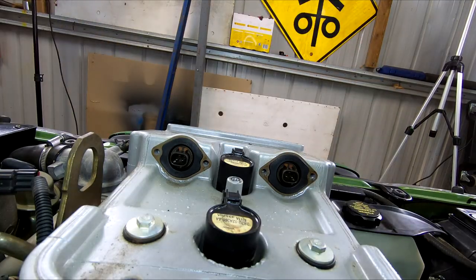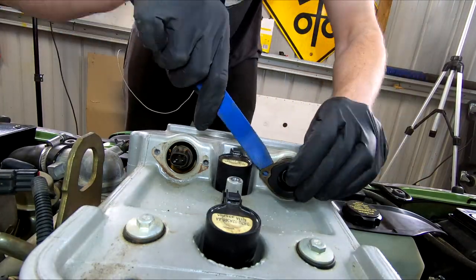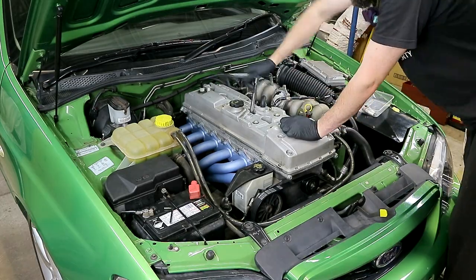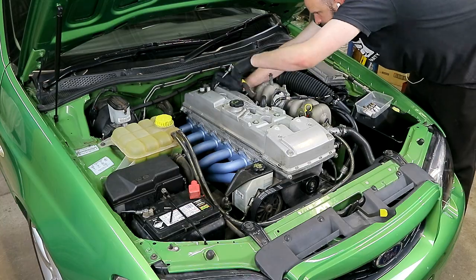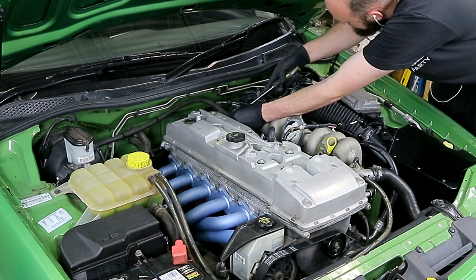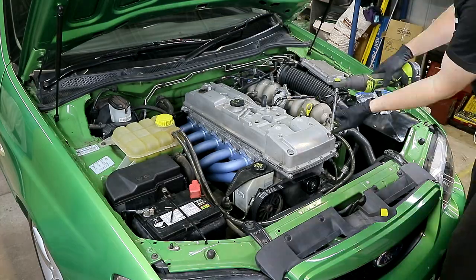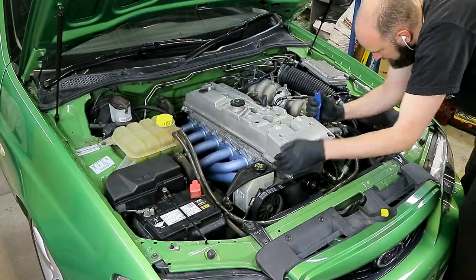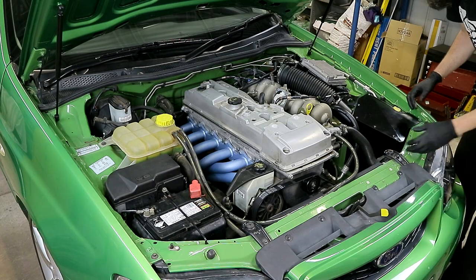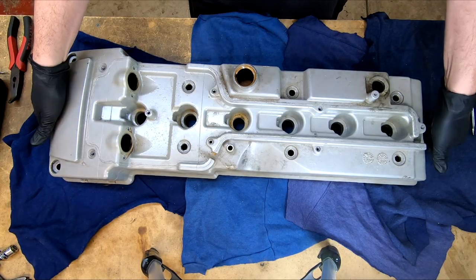On FGs onwards, I believe these cam phasers can be unbolted and removed with the cover on, but this isn't the case in these earlier cars. We'll have to instead move the cover backwards to clear these in a minute. Coils can be lifted out and spark plugs removed — for tips on doing these, see our service and spark plug change video. I've also removed the vacuum line for the brake booster to make life a little easier — just remember to put this back on. Finally, we can remove the eight rocker cover bolts, which are a mix of 10mm and T40 Torx bits. Remove the cover by first pushing it back slightly, then lifting over the cam phasers. Bring the cover forward and lift the rear to clear the rockers and work it out from there.